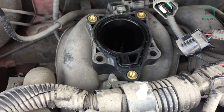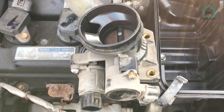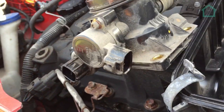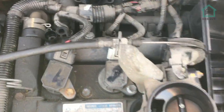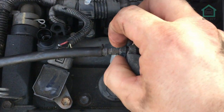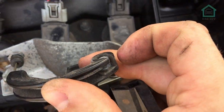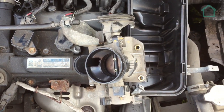We've removed those three bolts and the brass receptacles. The throttle body itself is out — there were two electrical connectors, completely different shapes so you can't get them wrong when putting it back. We need a 12mm spanner to undo the lock nut, which releases the cable — it just pulls out. So let's get that cable off and then we'll get the throttle body cleaned.